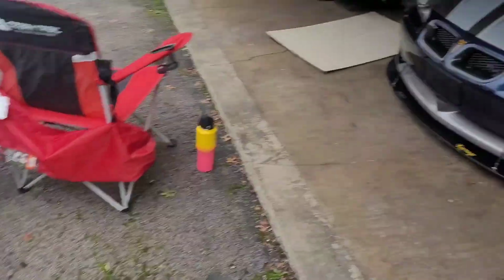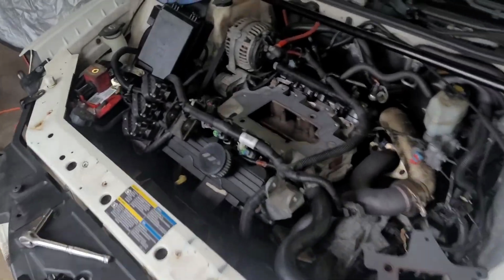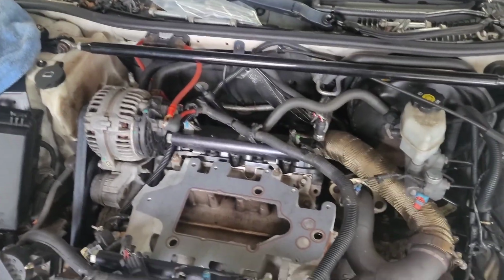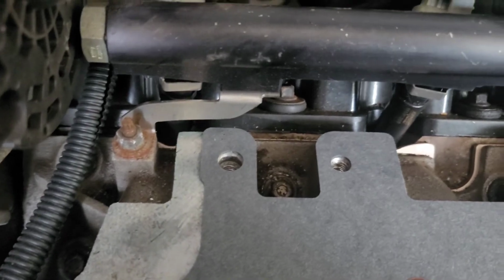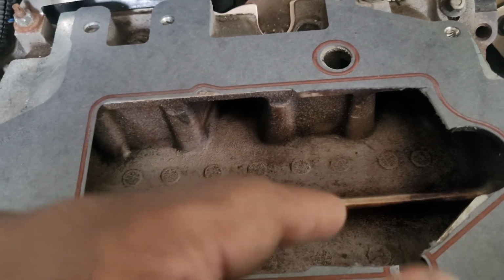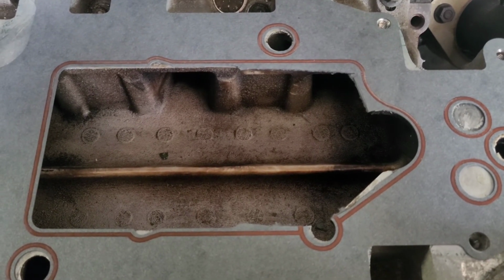Now, on to this one. So it'd be wise to use ZZP fuel logs. So if you got fuel logs, go ahead and install them now. So put your injectors on, bolt them down, and then bolt them down right there. Okay, now, I use this type of gasket. So my lower intake manifold is cut. Acknowledge that right there. Cut yours like that.